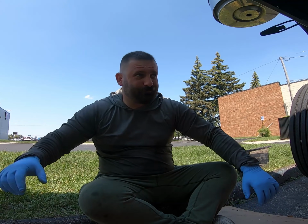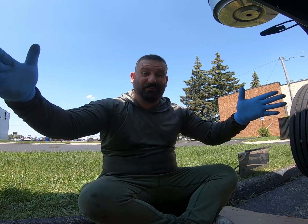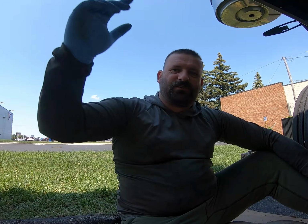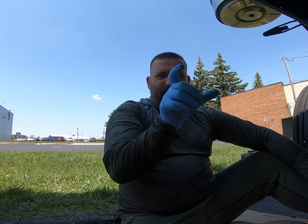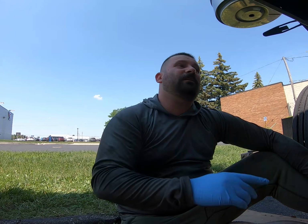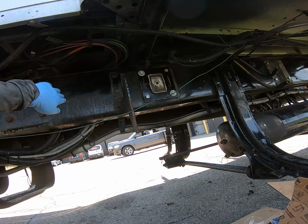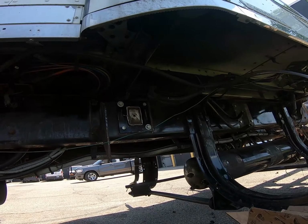So a couple of things that I need to do, and I already did on the other side, is start moving where the battery boxes mount. On this truck, initially it had the 45-inch, but the way the 45-inch sit, it would actually be past where the exhaust comes out, and it would require me to still run the Kenworth elbows, which come down and then go back underneath the truck. I don't like this style, I like the straight up, but it means the battery boxes would need to be changed. So that bracket needs to sit forward, so it exposes this area right here for the exhaust.